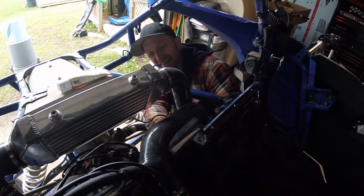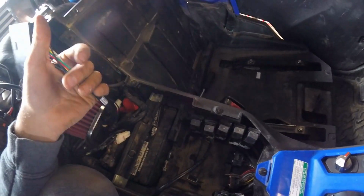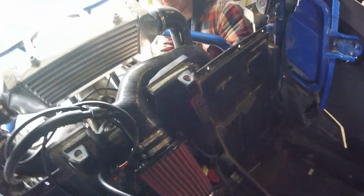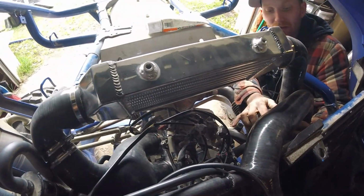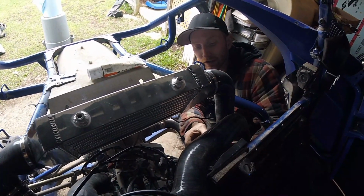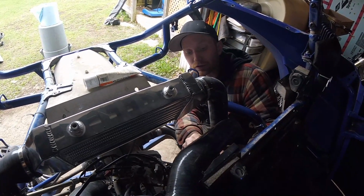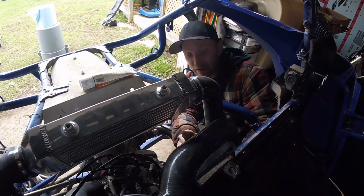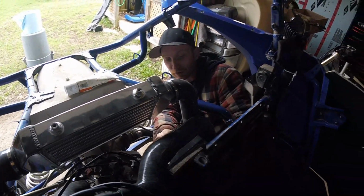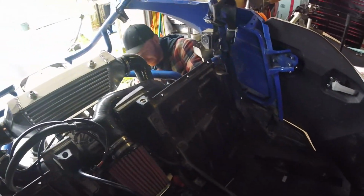Yeah, I know. The ECU that Jamie had ordered actually had an exhaust tune on it, and apparently it screws with the timing. The timing is way too far advanced on an NA tune or whatnot, which is really bad for this turbo setup. So we'll let it idle and check for leaks and stuff like that. I don't really want to drive it because I'm not going to grenade it just because I don't want to wait 2 weeks for an ECU. Unfortunately, like I said, I know everyone's going to hate me for this.